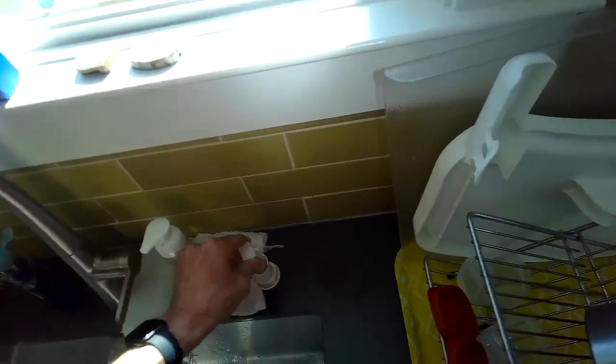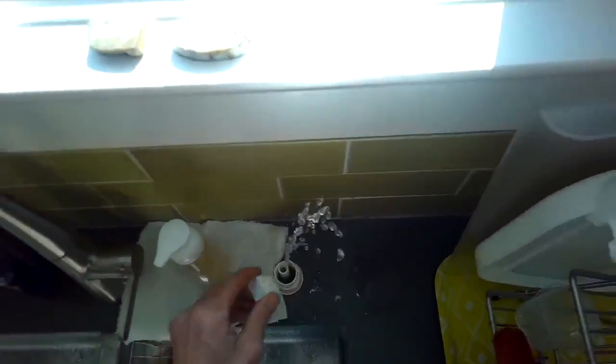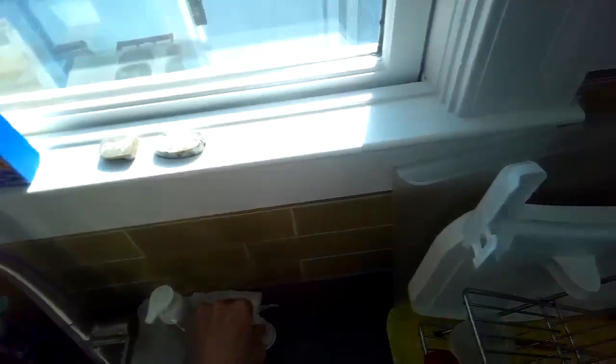Alright, there we go. And now when we set it to drain, just by closing the door it'll activate the drain. What we notice is we get a column of water squirting up. Usually the column only goes about 3 inches high. This one shot way up, so it means there's something partially blocking that small inner white tube.